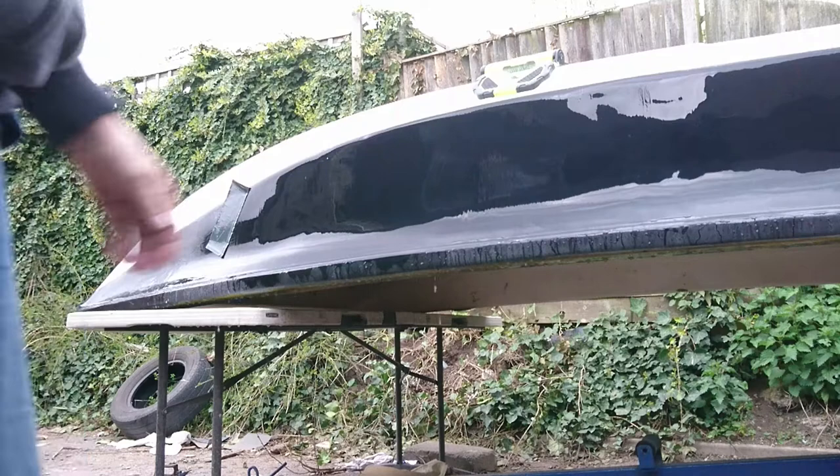That's basically what I'm doing on the flat inside of it, and then I'll bring it back when we come for polishing. What I'm doing with the torch is going around - you can see a couple of areas. You pick up on bits that haven't been flatted yet. It should look like glass when it's wet and pretty much give you the shine. I've got the torch to see if it lights up the blue - you can only get a light tinge of it. I think when the sun's on it it'll be a lot better. I'll put some blue pearl on it - it's only a test, it's going to get sanded back and done properly.